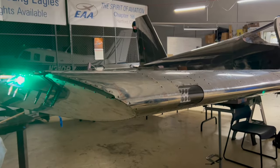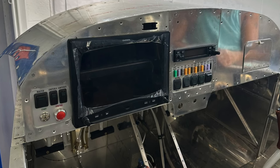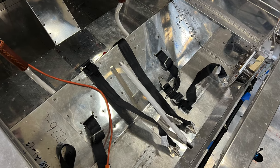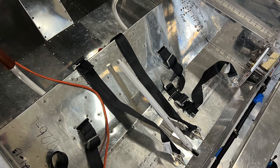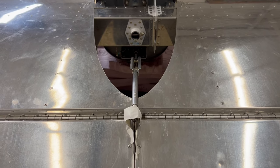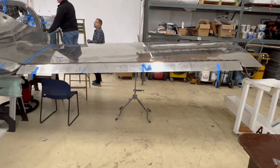We've made a lot of progress. At our last video we were working on the lighting system and verifying all the connections, and wrapping up installation of all the instruments in the instrument panel. Since then we've started working on floor paneling, installed the magnetometer and the ADAHRS unit. Tonight we're wrapping up floor panel installation. We also completed the stabilator connections and flaperon connections, so we now have three-axis control on this aircraft.